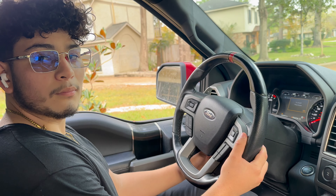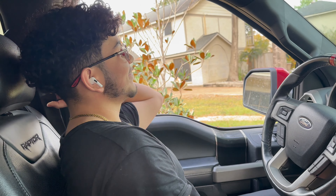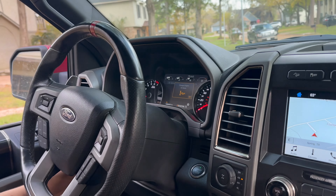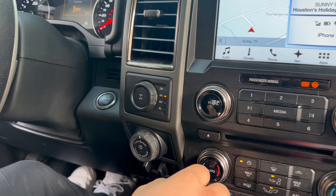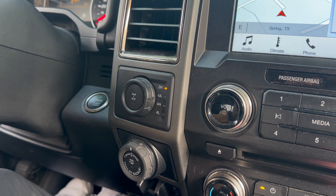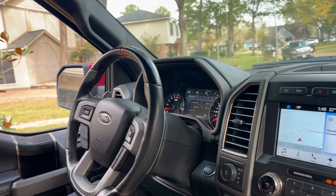I just drove the vehicle to go get Nate, so we should be able to experience whether or not this is still an issue. Go ahead, pop the vehicle on, put on your seat belt. Take it out of four auto — if you have a Raptor and you're experiencing this problem, putting it in four auto takes away some of the problem. Now that we're in two high, let's take her down the street. Right now I'm not hearing any chattering — it seems like this may have fixed it, but I don't want to speak too soon.